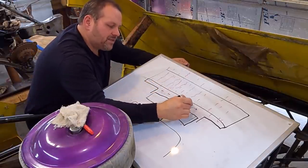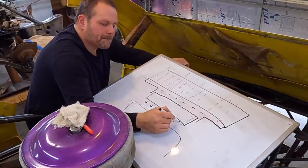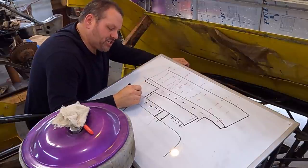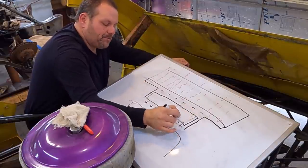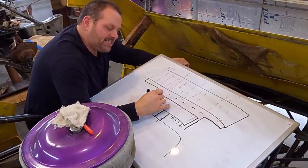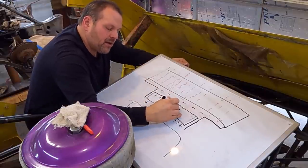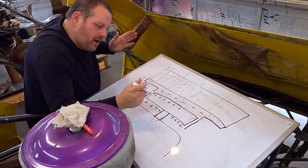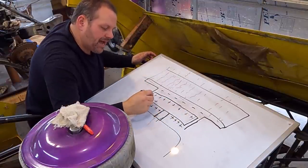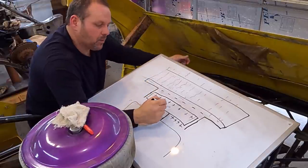So up here, you've got all this negative pressure. Back here, you've got all this positive, all right? If you extend this shroud on back, well, the positive pressure actually is in the blades themselves. So once that leading edge cuts into that air, it's gathering that air up and compressing it and creating this pressurized air. Pressurized and creating pressure in itself creates heat, by the way.